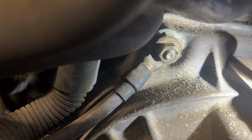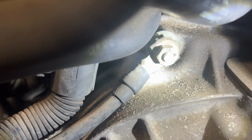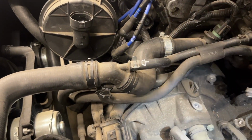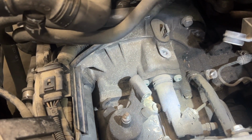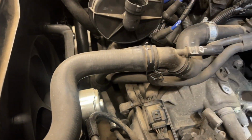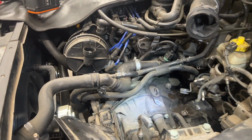That's the housing bolt one, and then here is the thing. Let's take an even closer look. That's the ground cable. It needs to come off. Looks like a 13. This one is a larger size, and then here are the starter ones, and then pretty much the only remaining thing will be the clutch slave cylinder, and then the bracket that holds the power steering line. That should allow me to go down to the bottom.